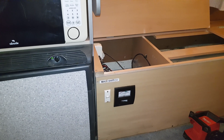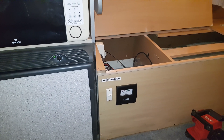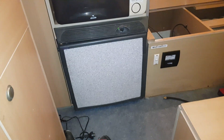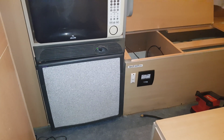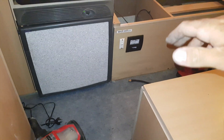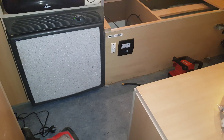Those VSRs are good for 140 amps apparently. The wiring on this one's not anywhere near heavy enough for that, but also you probably don't want it that heavy because AGMs don't like charging at any more than about 30-35 amps - it's a bit rough on them. You won't get the most cycle times if you charge it that fast.